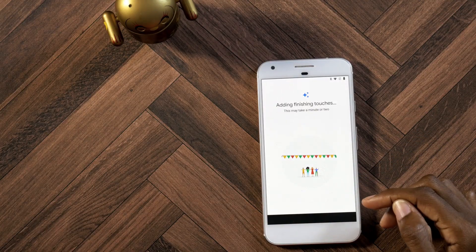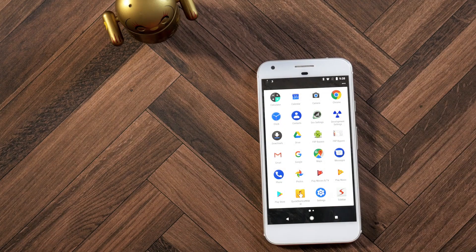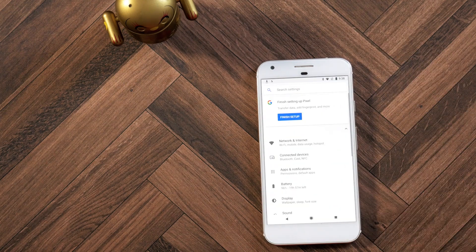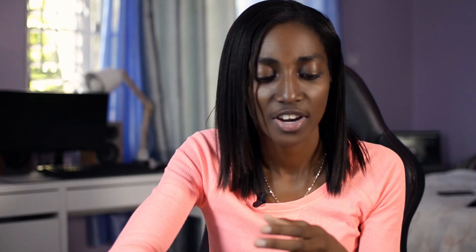I'm too pumped right now. And as you realize guys, there's no FRP lock icon on the top there — you're able to go into everything right here. If you go into settings and go to system — because before you couldn't get into developer mode — go down, click on that, and you're now a developer. This worked! Now, one thing I was thinking was that I could try to downgrade the firmware, making it easier to bypass the FRP. However, normally a lot of people do not unlock their boot loaders, so you're not able to downgrade your phone. Because if you don't have the boot loader unlocked, you're not able to downgrade. And if you don't have OEM unlock ticked on in settings, then you're not able to unlock the boot loader.